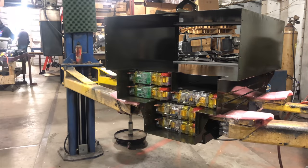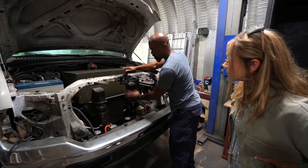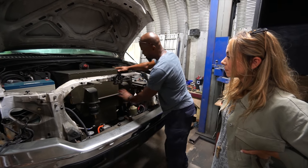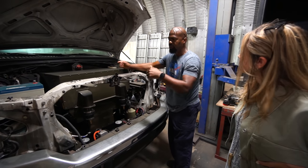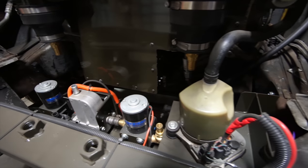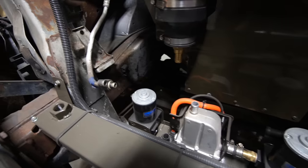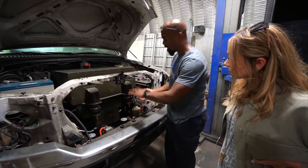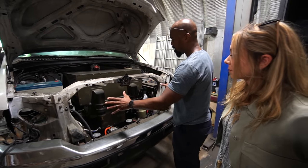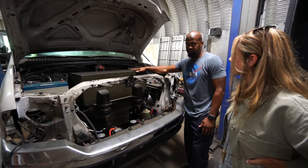Your battery management chips, and there's also a heating and cooling system. These two right here build up pressure but they disperse 16 inlet and 16 outlet hoses that go in cooling the Tesla water jackets inside of the battery box. We have a pump, a Tesla heater, a Tesla three-way valve which changes from either hot to cold, whichever one you're going to use. We have two radiators which are going to sit in front and cool and heat this box according to the optimal operating temperature.